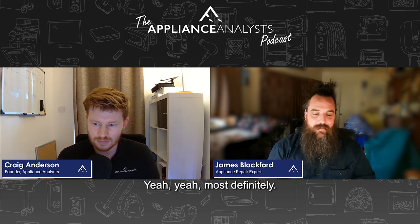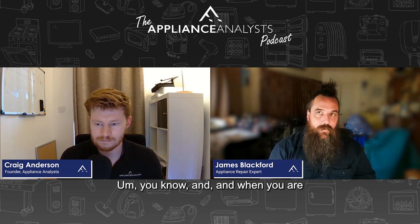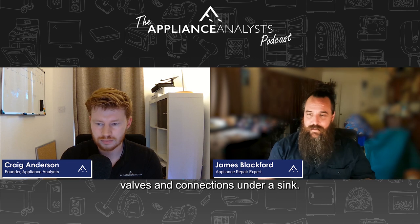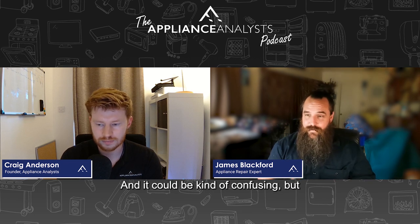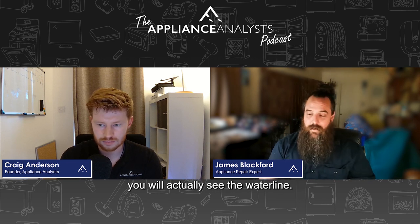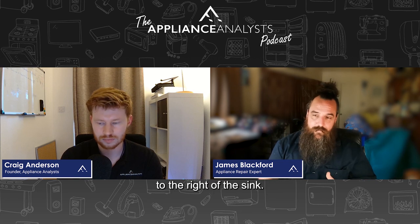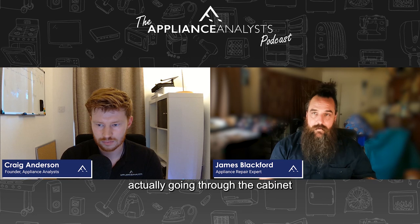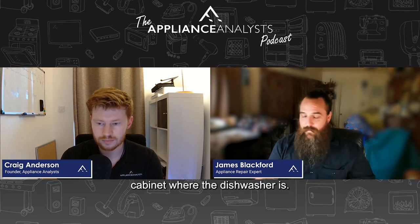Yeah, most definitely. When you are checking to see if your water is on, typically you will see the water line, because sometimes there's a couple of different valves and connections under a sink and it could be kind of confusing. Typically the dishwasher is to the right of the sink, so there'll be one water line going through the cabinet from underneath the sink to the cabinet where the dishwasher is.